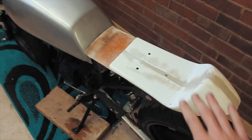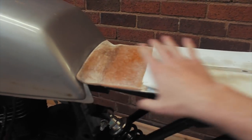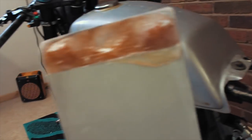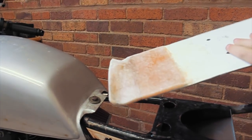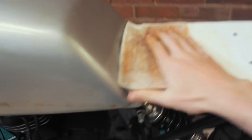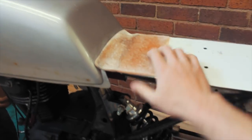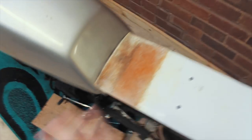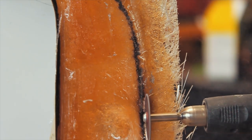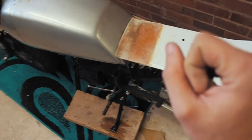You can probably see I've actually made a bit of progress on the seat. I've made a fiberglass extension that fits nice up against the tank. If I just remove that, you can see I have a couple of layers of fiberglass. It looks a bit messy underneath, but I've done a few layers, shaped it so it fits over the tank nut and the tank itself. I still need to trim around the edges, but the shape is there. I piled on a load of fiberglass, matted it over, built up the layers, trimmed off the excess, then used the grinder to flatten it down to give it the base shape.